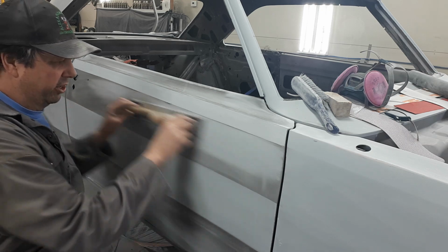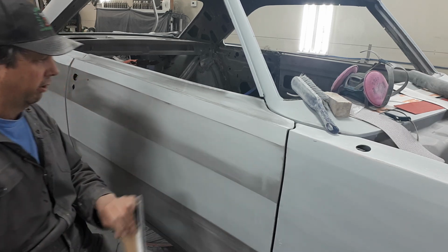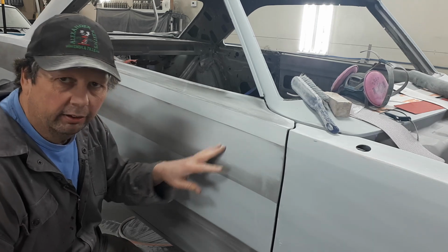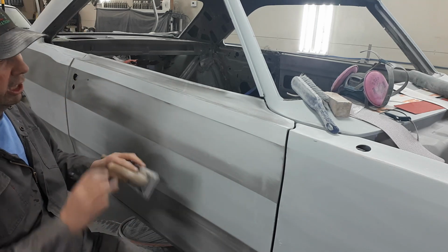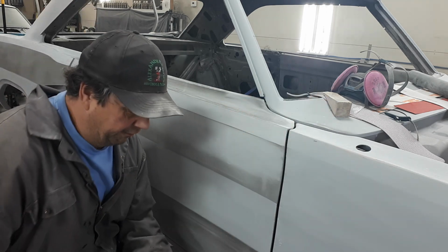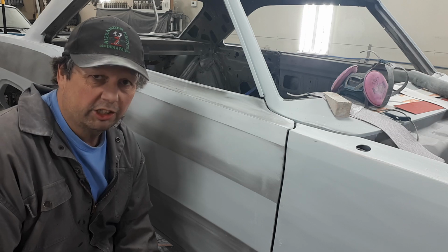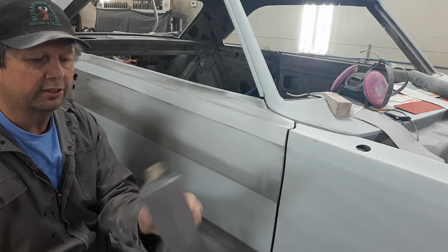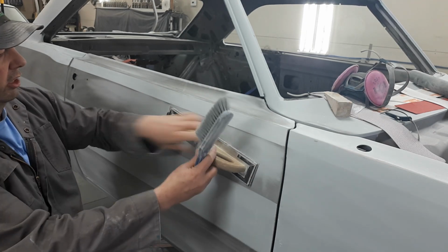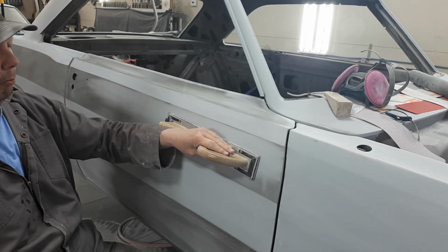Now, as I said, you can see that our makeup's disappearing, but I'll guarantee you we're not 100% 180 grit scratching in there yet. It's still raw. So keep on going. And if you do use these, a method that a fella showed me years and years ago, that I actually do more than anything, is I hold it like this. Put it on the surface, then you can take your arm and kind of lean on it to even the pressure out.